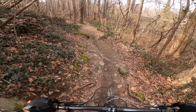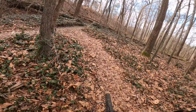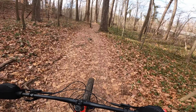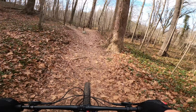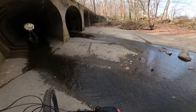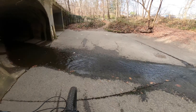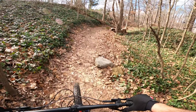Up front on the bike is a RockShox Recon fork with 130 millimeters of travel. It's an air fork so you can set your pressure, and you can also adjust the rebound. Unlike my previous SR Suntour, the rebound damping is controlled by a little tab on the bottom leg of the fork that you spin — maybe 180 degrees — and it clicks into each setting, so it's very easy to know how many clicks you are from one end of the spectrum to the other. It offers a good range from springing back almost immediately to a very slow rebound — probably slower than I'll ever use, but handy on certain rock gardens.